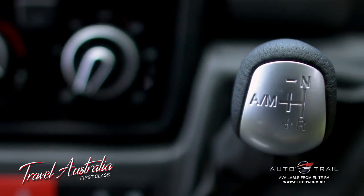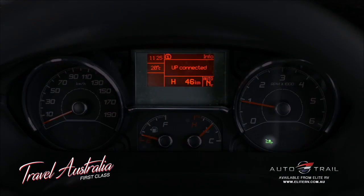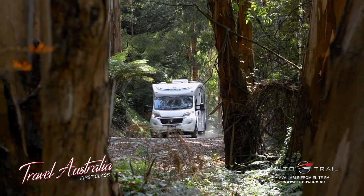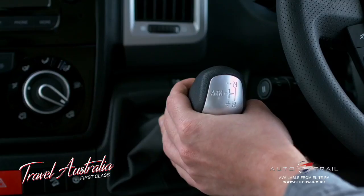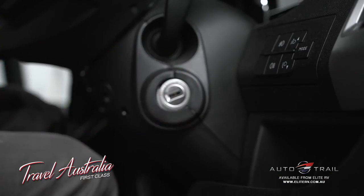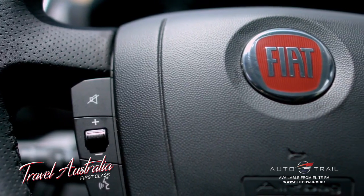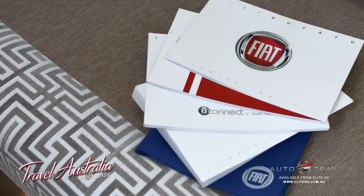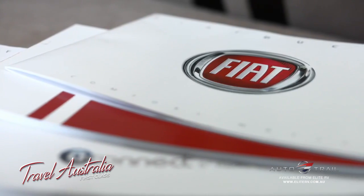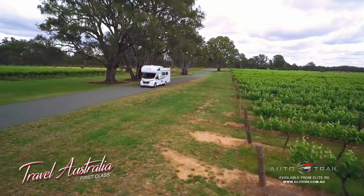Comfortmatic also has a great function called UP. When you push the UP button, the system modifies the shift pattern to deliver maximum power and efficiency going up and down hills. When parking with Comfortmatic, you need to be in gear. If the engine is turned off and the gearbox is in neutral, the motorhome will emit a beeping sound to warn you to put the car in gear. It's highly recommended that the Operator Supplement Handbook for the Comfortmatic transmission is read and fully understood before you head out on any major journeys.